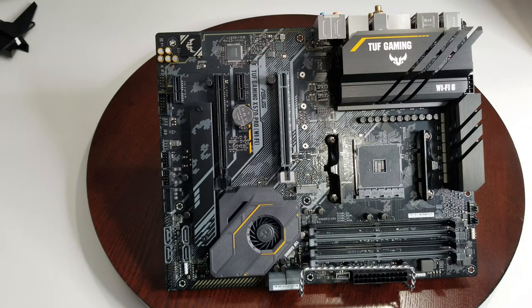Of course, as I mentioned, it has the chipset. It's the AMD X570. And the CPU socket here, it's an AM4 for 3rd, 2nd, and even 1st gen AMD Ryzen processors, and with Radeon graphics processors. Now, it does not mention anywhere, because usually they will mention whether it can accommodate some of the other CPUs, like a 3200G or 3400G or something like that. I have no indication that that's the case. So if you find that, let me know. I'll put it in the description for other people if they're looking at this video down the road.